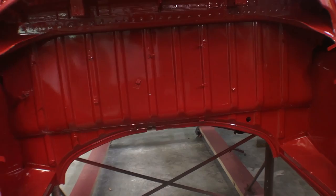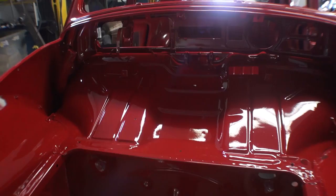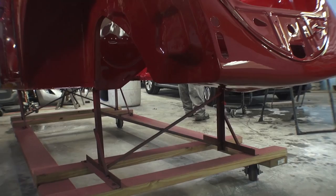We even paint into the engine compartments. A lot of times this is all covered with engine cardboard insulation, but we want to show the quality of the restoration and it's always good to take photos as you're progressing. Even the spare tire tub is repainted. These are areas that are mostly neglected, especially the trunk area. People feel they can just cover it with carpet, but when you go to buy a bug this is one area you want to check out, because people sometimes just do not want to paint the inside.